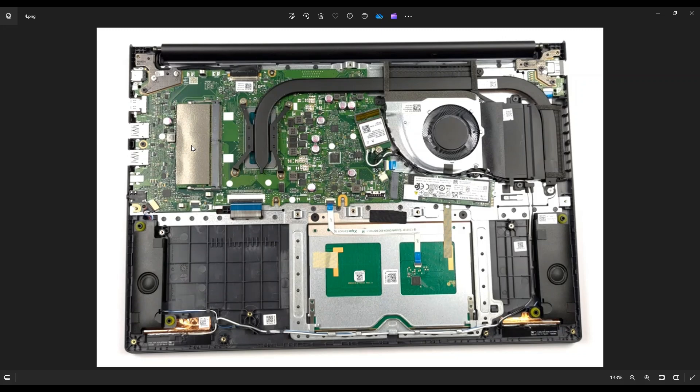This RAM is DDR4 3200 SODIMM — the RAM stick in this computer was PC4-25600. I'll include RAM upgrade options in the description link, including an eight gigabyte stick if you don't want to spend a lot, and a 16 gigabyte stick if you want to max out your RAM. I always say if you're looking for performance, RAM is a very cheap, very easy upgrade that heavily influences the speed of your computer. So I always recommend maxing out your RAM in any computer.